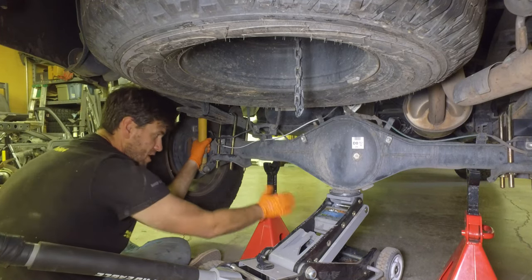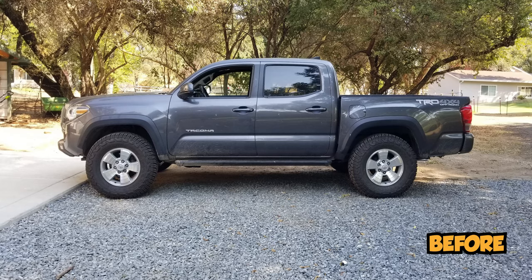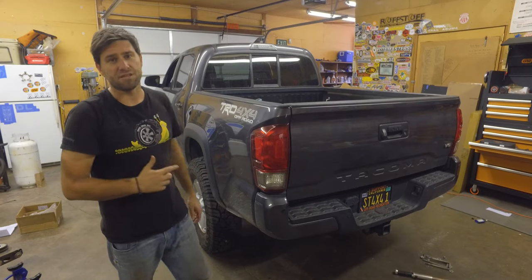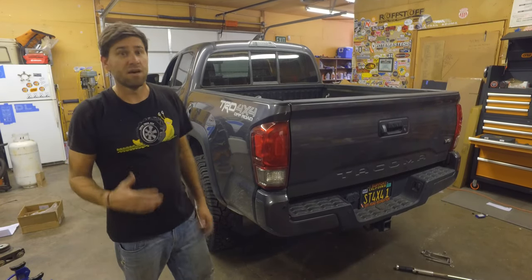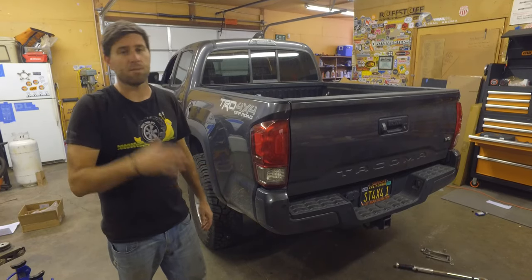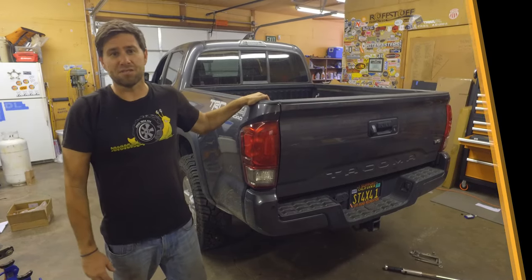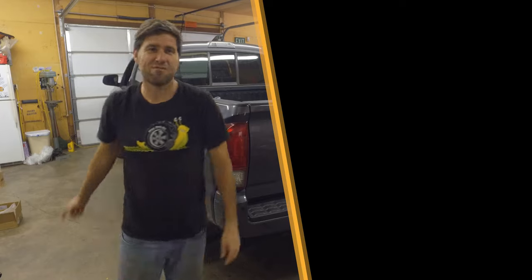Now we can just lift this guy up off of the jacks, get all that pressure off, and then drop it down and check it out. We got a quick easy spacer lift kit done here. I think the truck looks great — it's definitely taller and it definitely fits these 33s a lot better. We did only get two and a half inches of lift in the front; this kit was supposed to be a three-inch front, but we did get the exact two inches in the rear as advertised. The rear shocks — like I've said throughout the video — you're going to need longer ones; I'll put a link in the description for some shocks I suggest. Do get some lock washers for the rear, and you're going to need to go get an alignment because we did mess with the front. I'm super stoked, I'm happy you watched it, and as always, keep crawling.